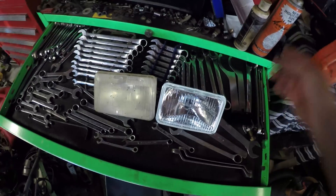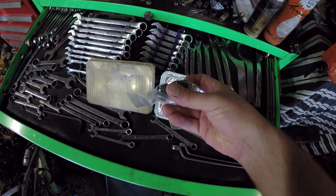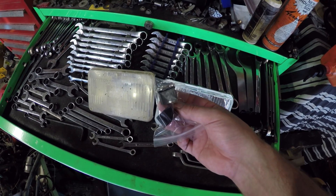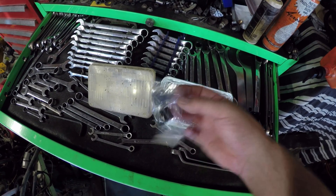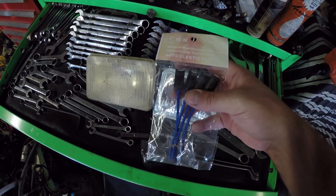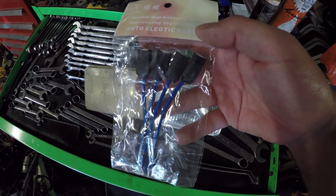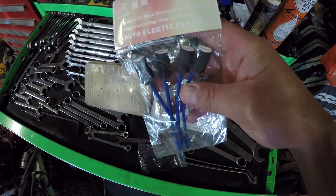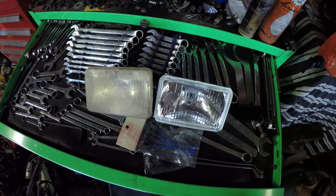The new connectors for the H1 I've already got in. I'm going to have to make my own for the high-low beams. I got these off eBay or something — it is really hard to find something if you don't want to do any splicing for the headlights. The high-only connectors I think came out of China, but they actually look like they'd be about the best choice. Ceramic fitting there, it's actually a pretty nice looking kit, and they are 14 gauge wire if I'm not mistaken.